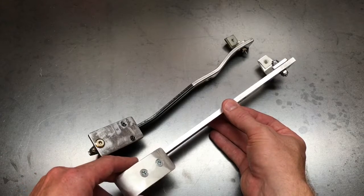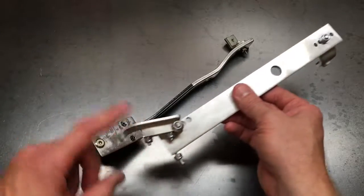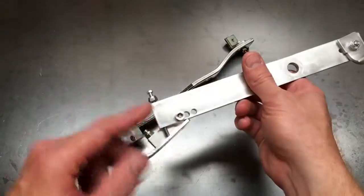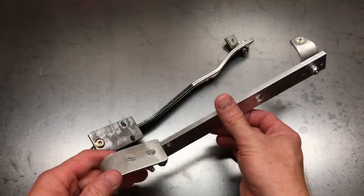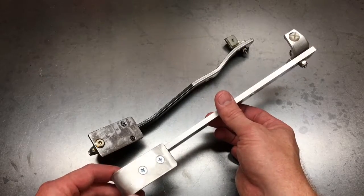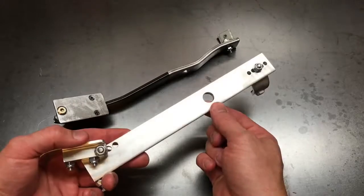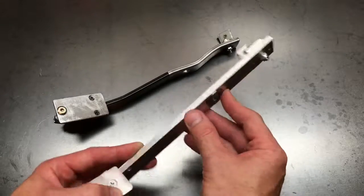With the second design I aimed for adjustability. I added holes where I could move the throttle cable up and down depending on where the pivot in the car was, and I did the same for the pad. I threaded an 8-32 nut at the bottom of this quarter-inch aluminum, so you can loosen this nut, get the angle and position you want, and secure it. Also, at the pivot point in the car I had some binding, so I turned a bushing — this actually pivots on a steel bushing for a nice smooth action.